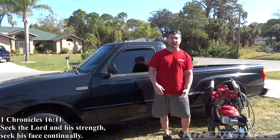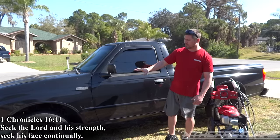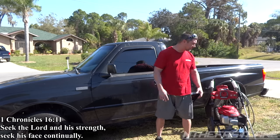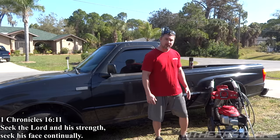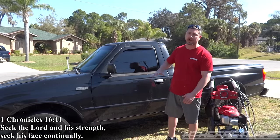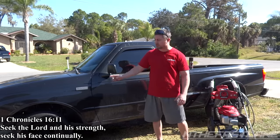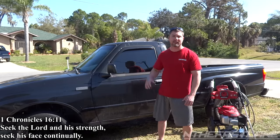Hey guys, in the fast lane here. In this video, I'm going to be painting these rims the same color, but they got a lot of brake dust on them, so we're going to clean them up with a pressure washer. I'm painting them now because in a few hours I'm going to be changing all the tires — paint them now while it's got the old tires on there, so you don't have to worry about overspray or anything getting on the new tires.